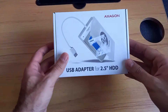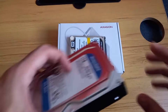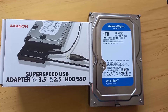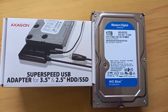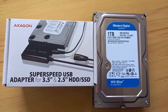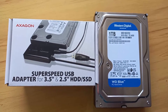Why is this important? This is important because you will need to purchase an adapter. Usually it comes in a box like this. Unfortunately, this one is only for a laptop hard disk, but for our desktop hard disk we need to buy a USB adapter. For this 3.5 hard disk, I have bought this adapter, which is compatible with both 2.5 and 3.5. The good news is that it works with classical hard disks and even with SSDs, which you might want to use if you have an SSD instead of a hard disk.